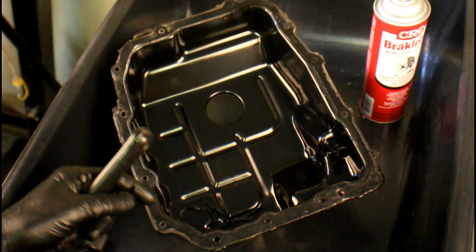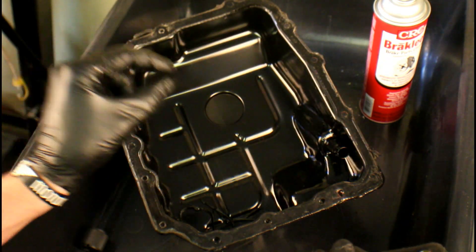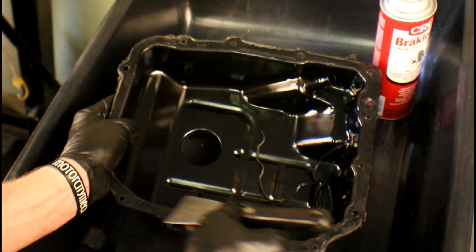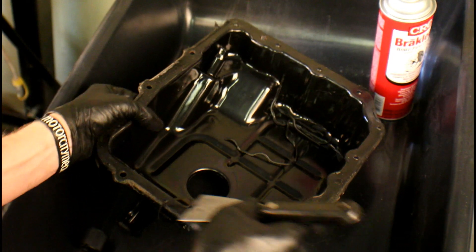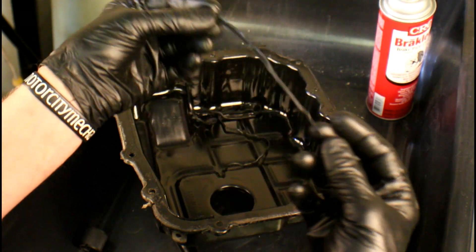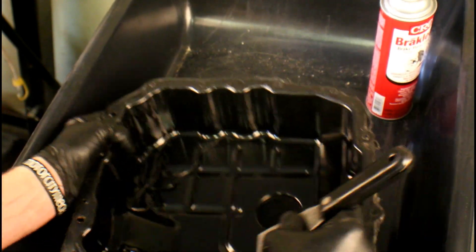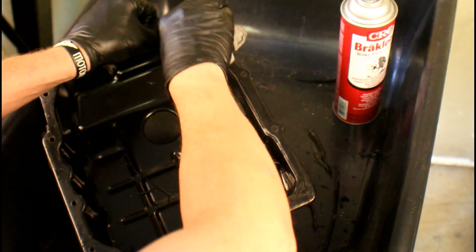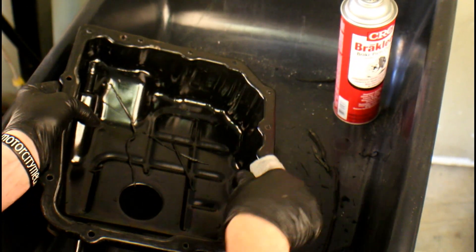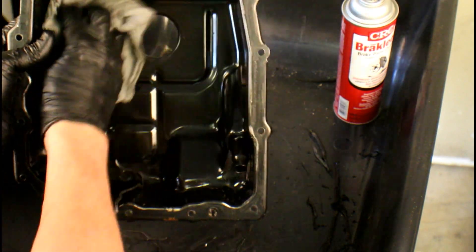You can scrape the outer edge with a flat pointed putty knife — basically the same thing we used to break it loose earlier. Then follow up with a razor blade, scrape across it, and it gets all the excess off. Then hit it with some brake cleaner and apply a new bead. Grab your putty knife that's got a sharp end on it, find a corner, and just start working your way around — raising up the little excess pieces of RTV. You'll end up with strands, so just repeat this procedure all the way around. Grab your rag, go around the outside edge and peel off any excess pieces that may be hanging on. Once everything looks good, hit it with the brake cleaner and get it ready for a new bead of RTV.